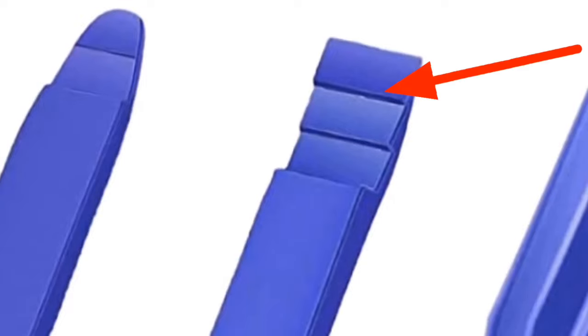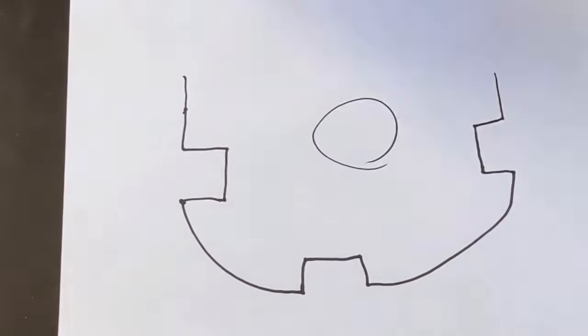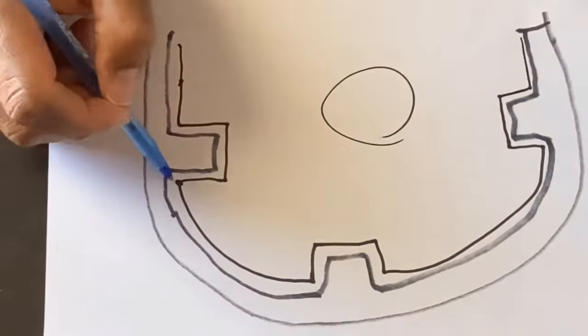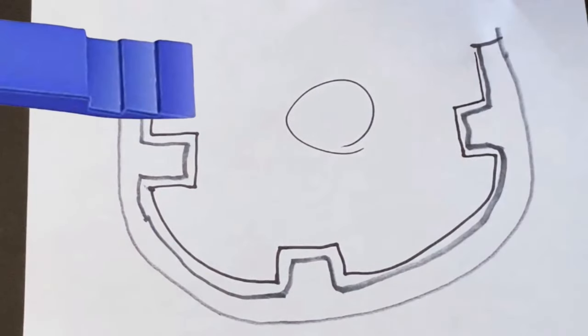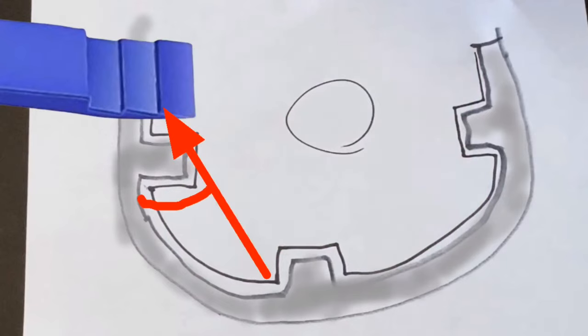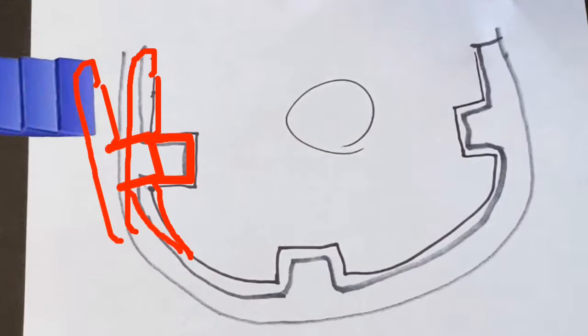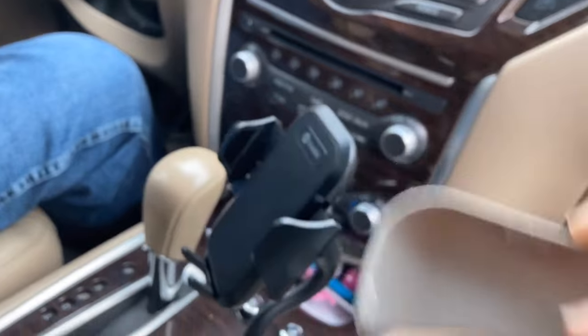Notice the trim tool has two notches — the first notch is the one you're going to use. I'm drawing the base, which is what's hooked up to the car, and then the actual plastic part you're trying to get out, which is hooked to the base. With that special tool, you stick it to the side because it has a sharp edge that can get in between the part and the base. That edge is what actually pulls the part — when you pull it, that little notch comes out and then you can pull the part out.